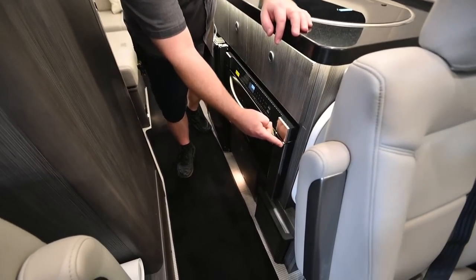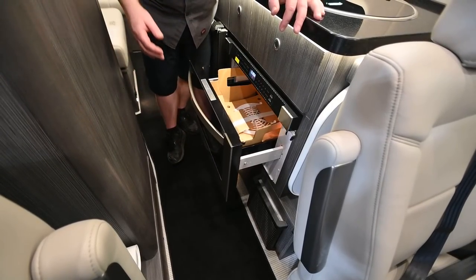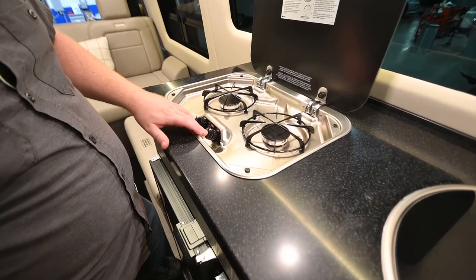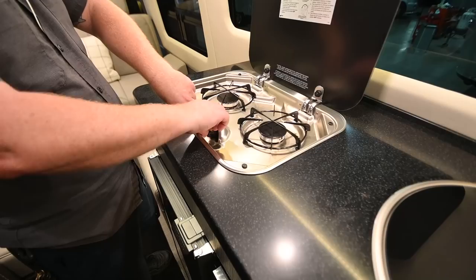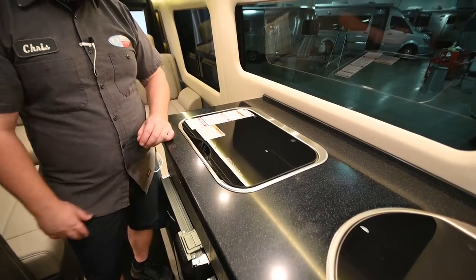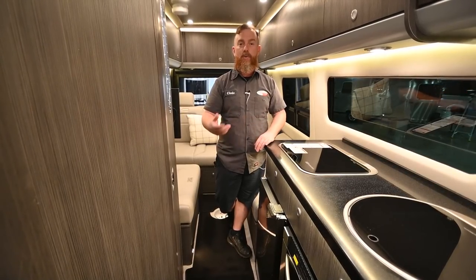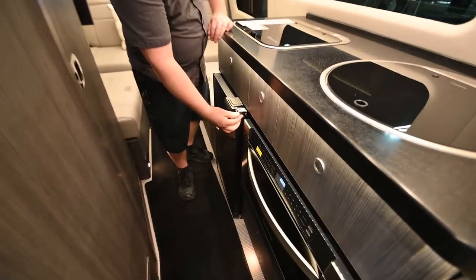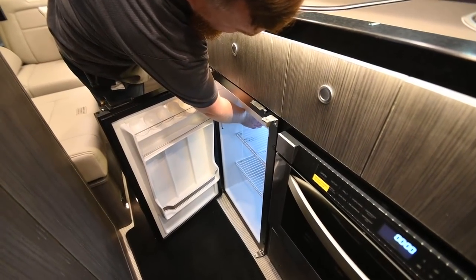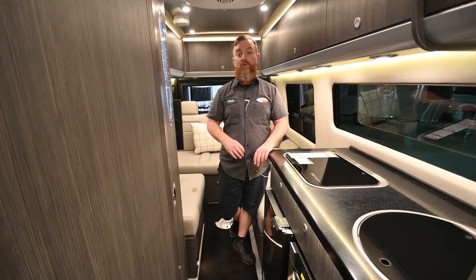The microwave has a little keeper keeping the door shut. The microwave is only going to work when you're plugged into your shore service or when the generator is running. The range lights pretty quickly — I'd suggest holding the igniter down before you turn the knob. It still has a glass top, so give it a chance to cool before you close it. The refrigerator is an AC/DC fridge — if you're plugged in or the generator is running, it runs off alternating current; if you pull that, it switches over to the house batteries. Inside, there's a knob zero through seven — zero is off, seven is the coldest. This refrigerator takes two or three hours to get completely cold. We recommend plugging it in and letting it get cold overnight. Once completely cold, it'll stay cold without external power for five or six hours.